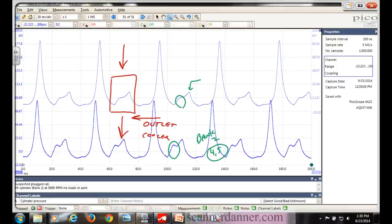Drilling and measuring is my only option - better than holding it and looking at it, and even looking at it doesn't tell you because you can't see all those paths in that honeycomb cat, and you won't even be able to look at the second one either. I'd like to follow this up - have Chris drill the hole, and we'll weld it up and take the measurement. Or just drill a hole and put a sheet metal screw in it. Do we have an adapter with our pressure gauge that goes in like that? We can make something. Then we'll do the drilling measurements. You can price your front cat because you're definitely going to need that - we're up in the air on your intermediate ones.